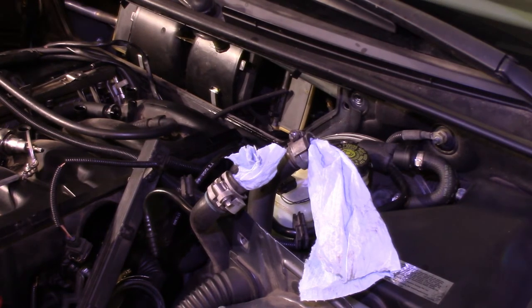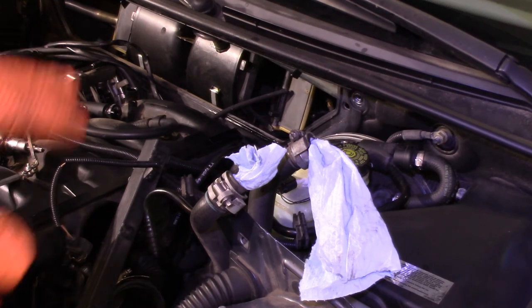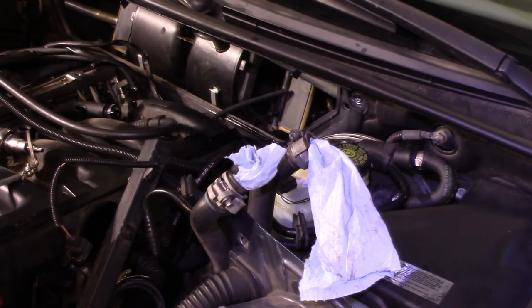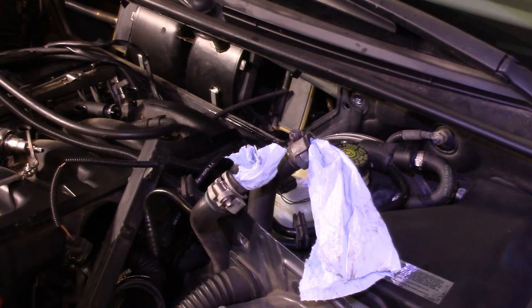So guys and girls — Dr. Cenkopotamus — I hope this quick video was helpful because this thing was a pain in the fanny. The next step, just as an aside: once you get it loose you can get it off — you've got to disconnect the fuel lines off of it. But once you have it to this point, if you're replacing the valve completely, it's got a little snap on it that you can't get to until you get the brace off. Once you get the brace off and disconnect the fuel lines from the brace, you should be able to pull the brace out. Thank you all for watching.